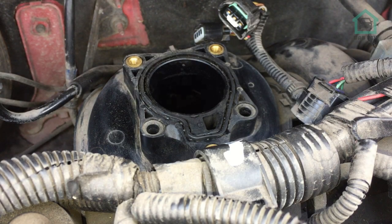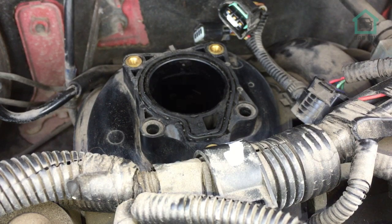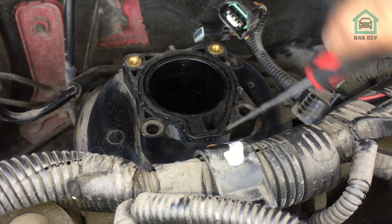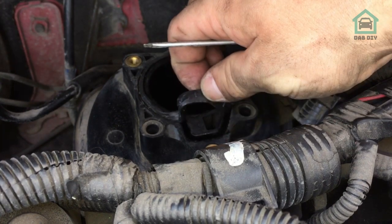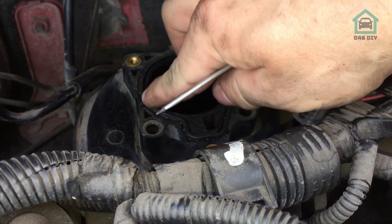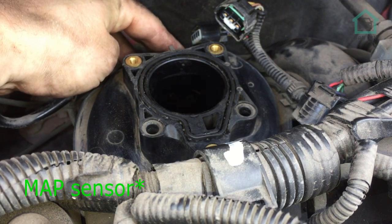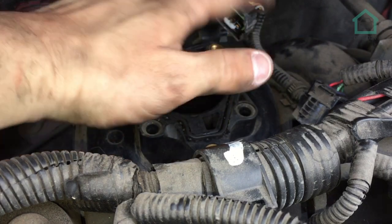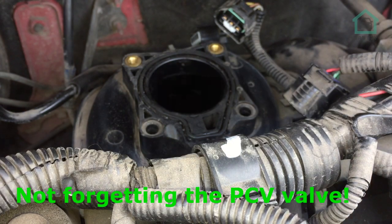We've cleaned around the general area, inside, and checked for any damage or loose articles. While we were there I had the gasket out and inspected it for any damage. Usually you would replace this gasket, but I'm not going to — number one, it looks fine and the rubber's still quite supple; number two, I don't have one. So I'll leave it in place. Now I'll pop the MAP sensor back in, put the throttle body back on, plug in all the electrical connectors, reattach the throttle cable, and start it up.